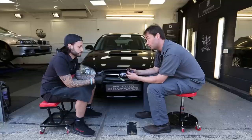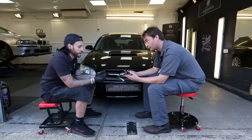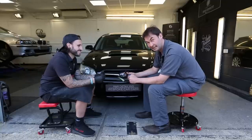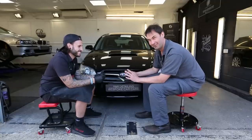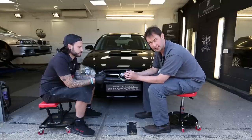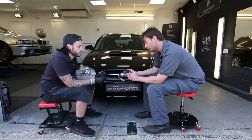In terms of application, you said you were really impressed — it was a little bit grabby, but he told you about that, and you just work around it. Really impressed. Hydrophobicness is perfect. Looking forward to doing more cars with that and finding out about durability. With ceramics it's about ease of application, hydrophobicity — aka beading for normal people — and of course durability. This Amethyst one you haven't tried yet — still a fresh bottle. With ceramic coatings they have lids that seal quite well, but once you've opened them there's normally a bit of a shelf life — they will start to crystallise around any areas exposed to oxygen. It's a little bit less durability than the 9H but still a very good product.